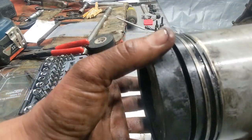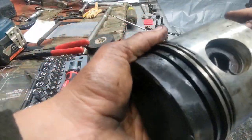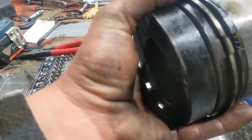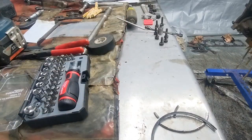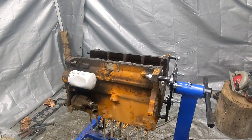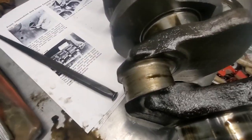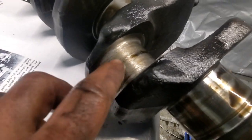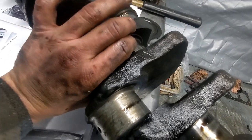Other than that though, pistons aren't in terrible shape. They're aluminum - I didn't expect that. A little bit of wear on the top side up there, but not in terrible shape overall. Wrist pin has a little bit of play in it, but it feels pretty tight. They're all about the same. That crankshaft dude is in bad, bad shape - that's all melted bearing material stuck on there and a bunch of other crap. That's really the worst one.